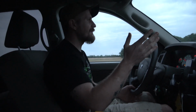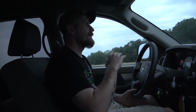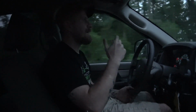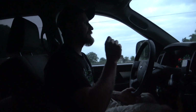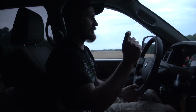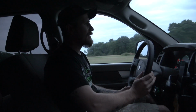If that feels good, if that looks good, if we don't put it on the bumper, if everything works out, then maybe we'll try to ride out second gear a little bit. At some point, I gotta hit the scramble button because we have to figure out how much it is, because ours is set up on duty cycle, not pounds. Right now we've got 10% duty cycle on the button, but we don't know if that's a pound or 4 pounds or what it is. Maybe we'll get into that tonight.